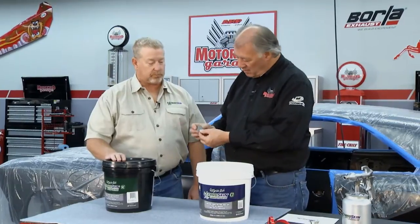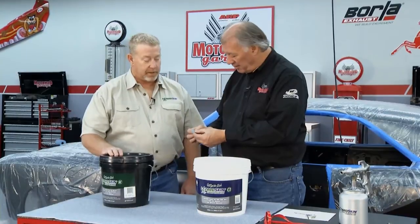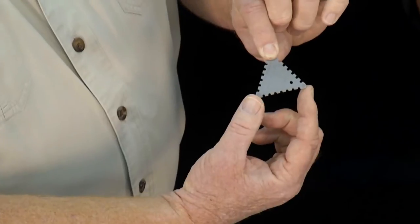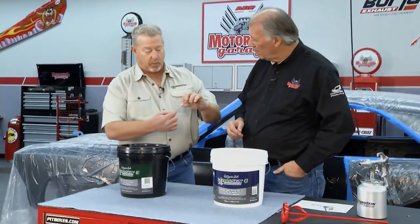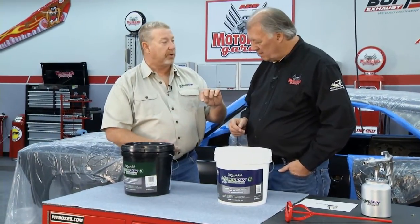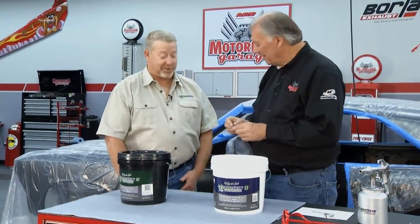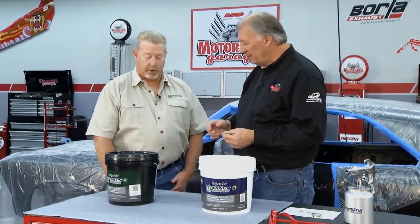We're going to go in with 2 coats at 20 mils per coat. And talking about the mils, what you have right here is a little gauge on that. Tell me about that gauge. This is a wet mil gauge that we use, and it's in thousandths. The corners are the exact same depth. The teeth are graduated. So when we stick it in that product, wherever our thickness is, it'll stop on that tooth. So we want to work our way to 20 mils on that coat. So this kit, they think of everything in it, don't they? Yes, we do. All right, so you've got your little gauge here. So eventually you want to have about 40 mils on it? We want 40 mils total.